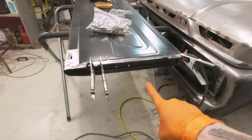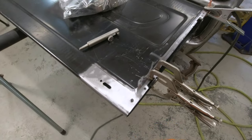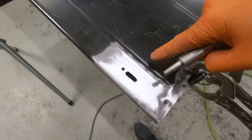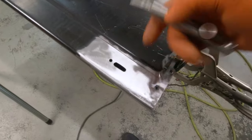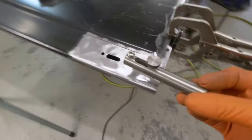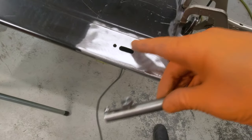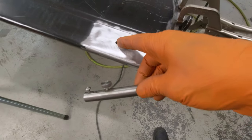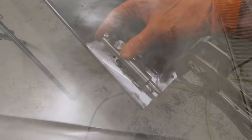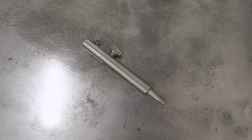Nothing visible from the outside of the gate. Since the chain and hook mechanism also functions as the latch to hold the gate up, we were running these hidden latches. That's what this is here — my dad went ahead and installed these. What you do is you insert these through the end of the gate, through a new hole that's bored in there. Then this knob sticks up through this slot area and that bolt holds it in place. These are a spring-loaded design and then you just go ahead and reach over top of the gate, pull that little tab, and it'll release the gate.